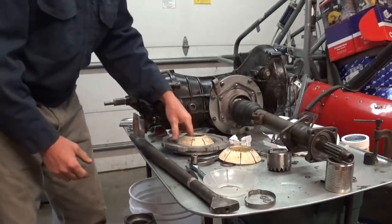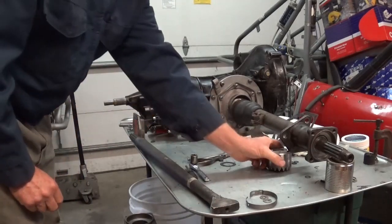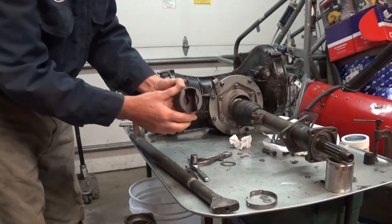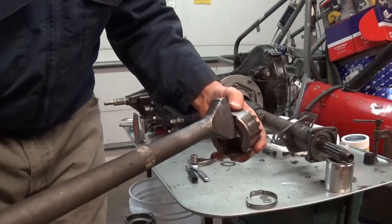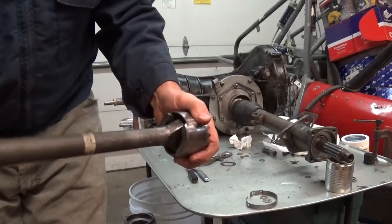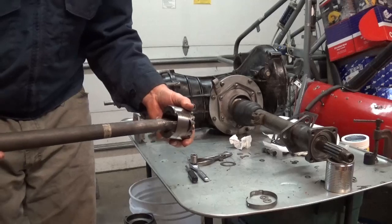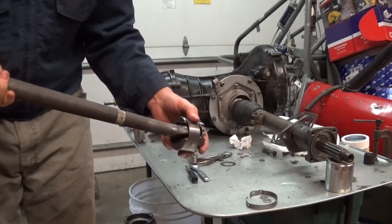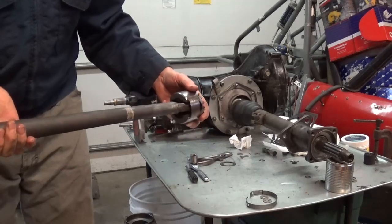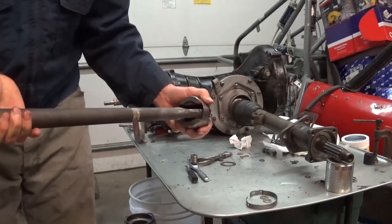Let's take a look at the CV joint per se, or how these things pivot. This is the side gear that goes into the planetary gears in the center of your differential. This is what the end of the axle fits in. As this rotates it can move up and down, it can move around — it wobbles in there basically. You kids making low riders with your axles and tires cocked inside — you are working the hell out of these things and putting a lot of pressure on the snap ring. These things are going to last the longest and run the smoothest when they are in there straight and level, otherwise this thing is just constantly rattling around.